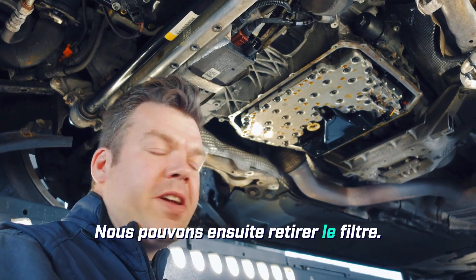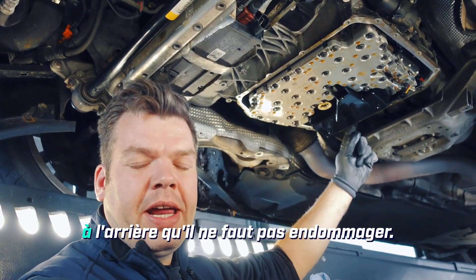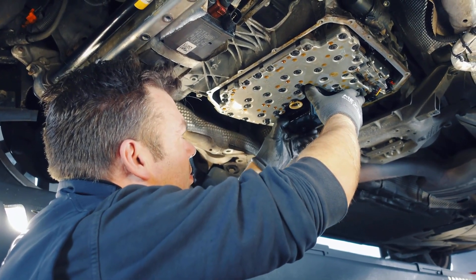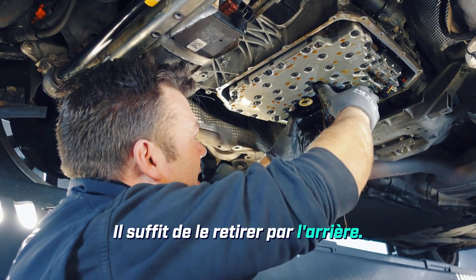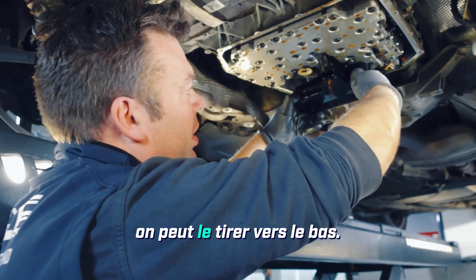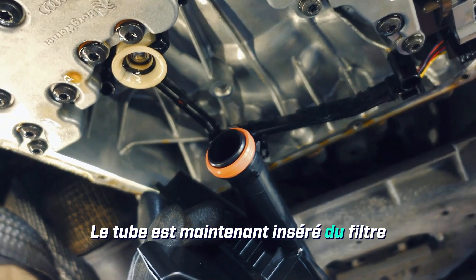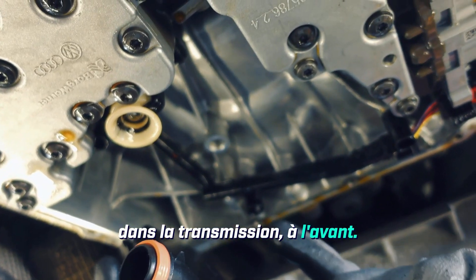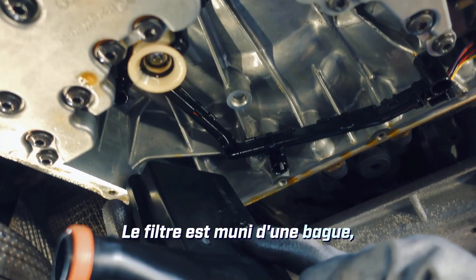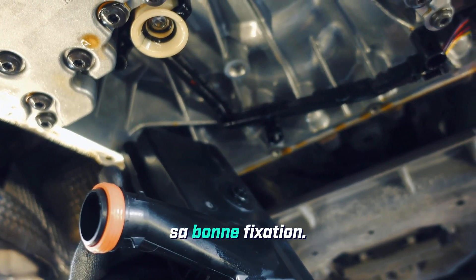Next, we can now remove the internal filter. We have to be particularly careful here because there is an electrical wire on the back that we shouldn't damage. You can simply pull it out to the back — you can hear it gurgling. A bit of residual oil still comes out of the mechatronics, and then you can pull it downwards. The tube is pushed from the filter into the transmission at the front, and after that, the filter needs to be pressed in up here. There is a ring on the filter, but it does not have a sealing function — it's only there to ensure the filter sits properly.